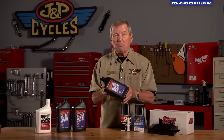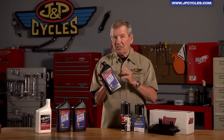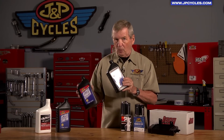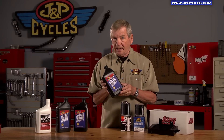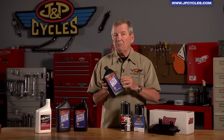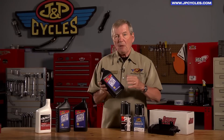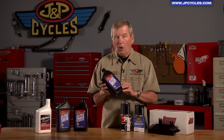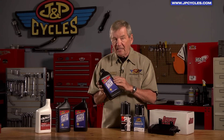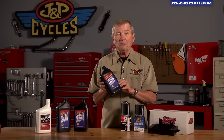We're going to tell you a little bit about our J&P brand of oil. This is an SAE 50 weight oil — a single 50 weight. What this means is, unlike our multi-grade oil, this is a 50 weight all the time, regardless of what the temperature is outside. This is an oil you might want to consider if you live in the hotter climates — if you're in South Texas, New Mexico, Arizona — where temperatures rarely get into the cold range, because an SAE 50 weight oil in a motor on a 40 degree day, I doubt that the motor would even turn over.